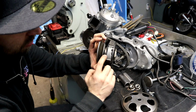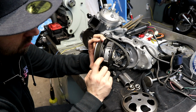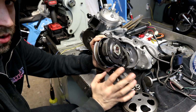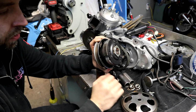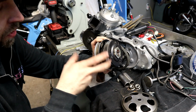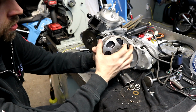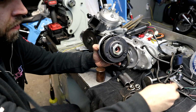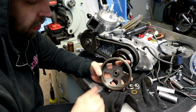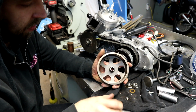On a lot of these clutches that have the internal ribbing, that's also another thing that will hit, these little lips on the inside. So it's really good to put this together and just check it over before you actually throw the whole thing on there, just assuming that everything's fine, especially when you're hodgepodging a bunch of different brands together like this. Just check everything, make sure that everything moves properly. And if you're installing a used bell, wipe the inside out.